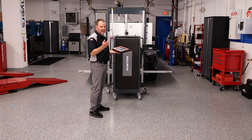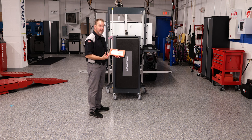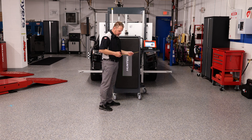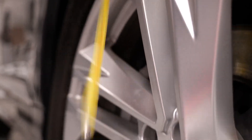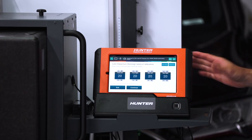It says calibration in progress, but it kicks you back out — and now it's going to ask for the wheel height. You're going to measure from the top of the wheel arch down to the floor on all four corners. Don't assume these vehicles are the same height on all four corners, and don't assume the front and rear are exactly the same, because they're not. Make sure you grab your millimeter tape, not inches, or you're going to have to do some math. Press continue and it's going to ask you to enter the values of all four corners.